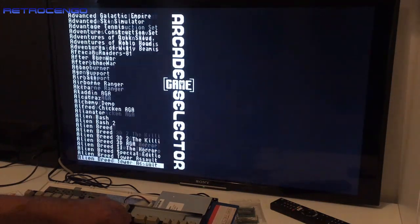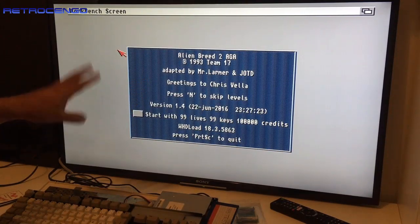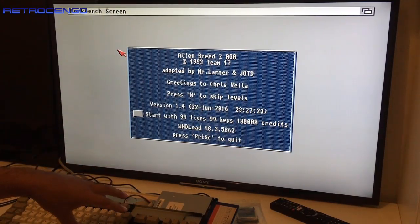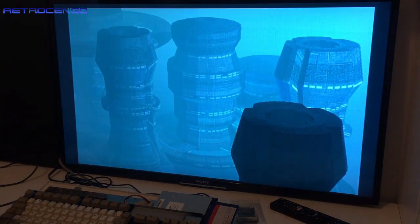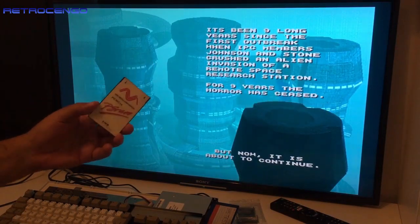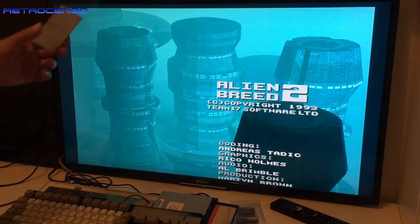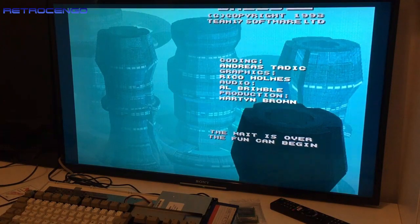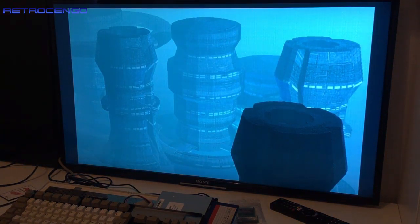Let's try Alien Breed 2 AGA version - this won't work if you don't have the RAM expansion, for sure. I think it was a four-disc AGA game - 2 megabytes of chip RAM alone is just not enough. One more note: don't buy a RAM card for the PCMCIA slot - that's not a great solution. It's for 16-bit Amigas; for your Amiga 600 it will work, but on the 1200 it's really slow. Thank you for watching - I hope you enjoyed these really cheap upgrades from Amiga kit. They just work. Take care of each other, bye!